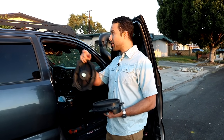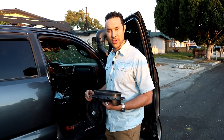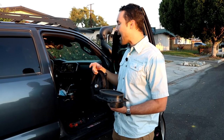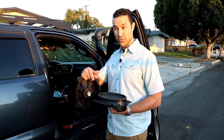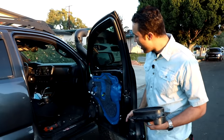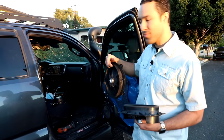As we talked about, you had to go from the driver's side to the passenger side sub just because of the storage bin size changes that Toyota made with this year model, as well as under the seat. Now that they have the power seat option for the 2020 year model, there is an adapter bracket that's necessary, but Jesse, your original amplifier bracket and assembly is used. It's just an addendum or a peripheral bracket rather that allows for the provisions for the new seat to be taken into account. So we just got the front 6x9 installed. We'll proceed to the rears. We're gonna do all the speakers first and then we'll do all your wiring and the amplifier.